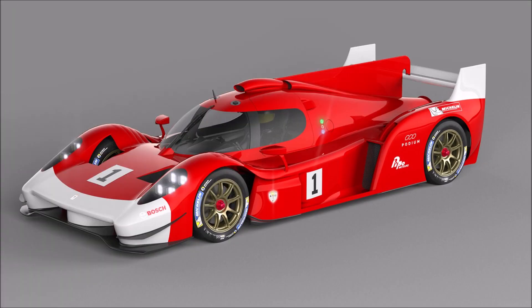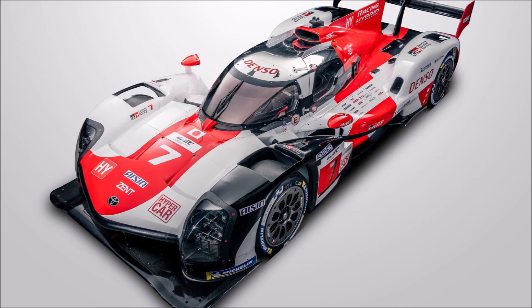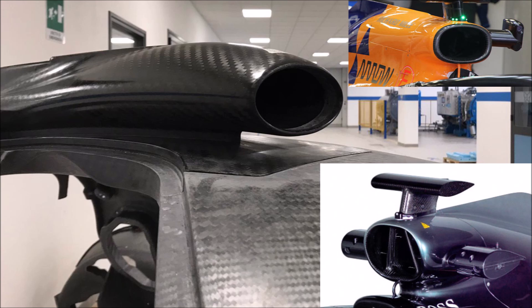While it's good to have one part of the intake further forward, one of the outboard ones could be obstructed by the center intake while turning. Also the two intakes either side will get some boundary layer of the surface in front of them. If we look at the Toyota, they used one large roof scoop further back and to make sure to keep high pressure in front of the inlet, they added fences either side. Also compared to other scoops, the Glickenhaus has a pretty small leading edge which will make it more sensitive to angle changes.